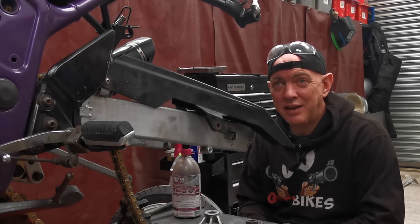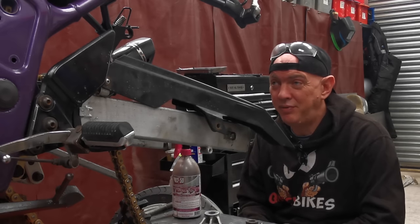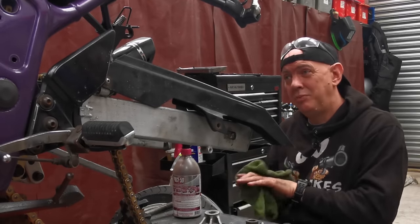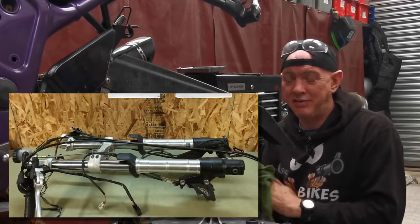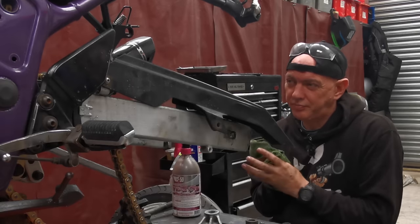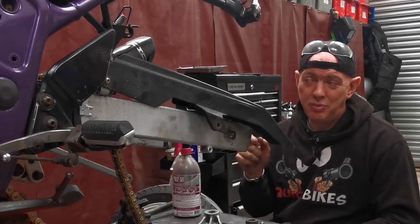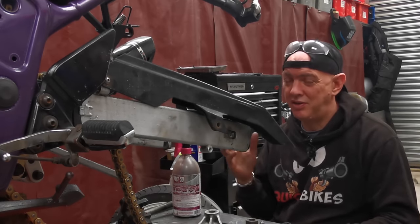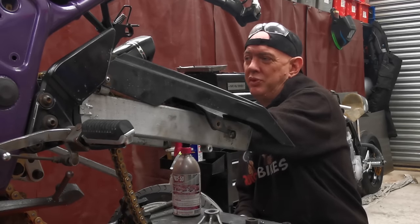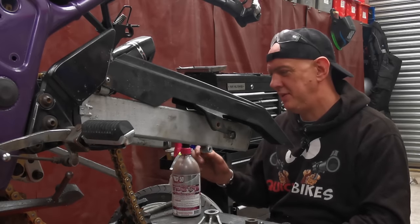I want to go for a set of Triumph 955 Daytona forks, complete front end basically. They look awesome. They would really be in keeping actually. I'll see if I can find a pick and shove it up. You can see what I mean. But that, without a front mudguard on, I reckon would look the business. And you've also got preload, compression and rebound adjustment because it's like a cartridge fork on the inside. So any handling troubles that we've got, we stand a chance of correcting by changing the suspension settings.